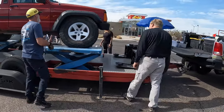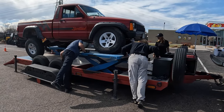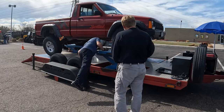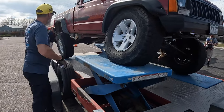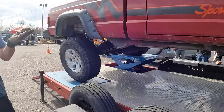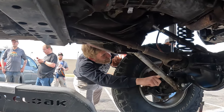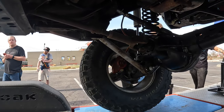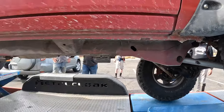Gotcha. That makes sense. Man, 17 inches out of the front, though. Yeah, I saw that arm hit the bracket. Can you show me where? On the other side, under compression, that lower arm, you can kind of see it. It hits that bracket when it shocks out, right? At the toe limit. Okay, I see that. Super easy to fix. It's just a little cut off of that rear, notching the bracket there to give room for that arm. Or put 44s under it, which is the plan.